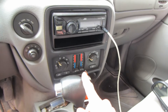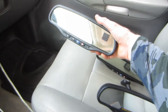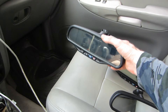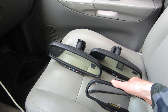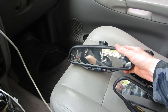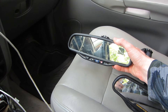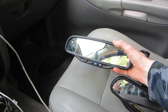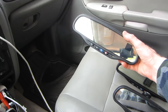The reason for that is because vehicles with automatic climate control are wired to display the temperature on the actual climate controls themselves. So if you put one of these mirrors that has the temperature display on your car, it's just going to read 'C' on the temperature line for no connection and it's not going to work. Other than that, just try to get something that will retain the same functions you had before. My old mirror has the passenger airbag readout and my new mirror does not — I will be losing that functionality, but I can always swap it out later for one that does. Also, adding a mirror with OnStar buttons will not give your car OnStar. The mirror only contains the buttons; it does not contain the modules that control OnStar functions.